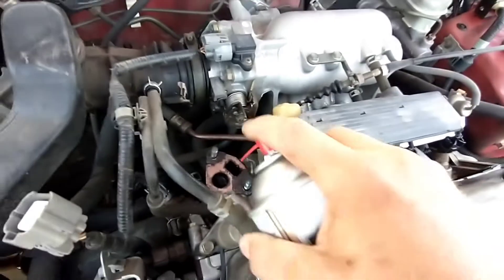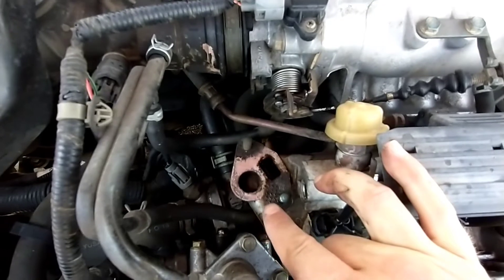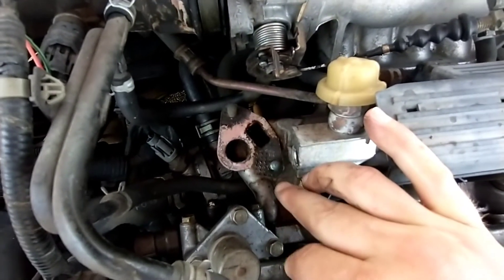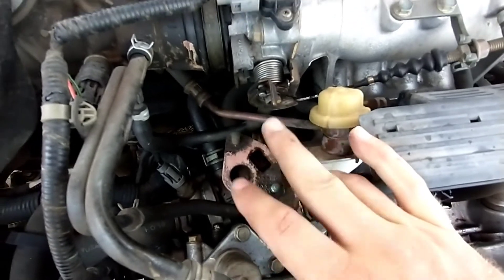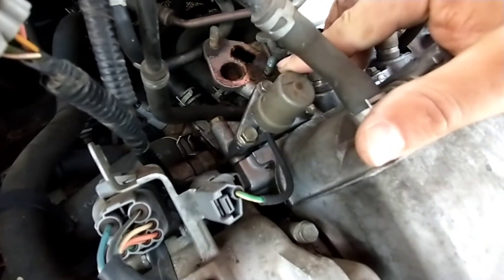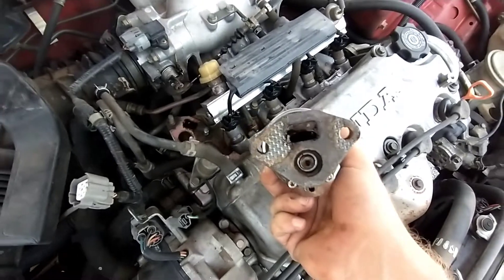Getting into cleaning out the EGR valve for this Civic: the round hole on the left is actually where the exhaust gas comes back from the exhaust, and that's done through the head of the D16 engine. The square hole is where that exhaust gas is recirculated back into the intake system. VTEC, baby — gotta love it.